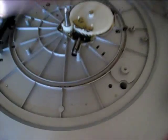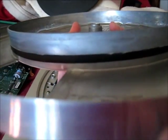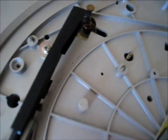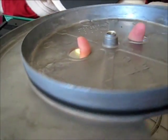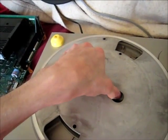What you want to do is pull the platter up and off. This is the second take of the video, so it came off easier this time. This is where the belt goes around — it goes on this motor spindle. You can see there are a couple of white marks on the belt from stretching it, so I've got to be careful. This is what it looks like underneath; the automatic return mechanism is down here — you can hear it clicking. The belt goes around behind the spindle, not in front. Make sure of that. So if you get a new belt or are reinstalling your current one, put it around the spindle and just leave it like that, then turn the platter back where it belongs and put it back down.